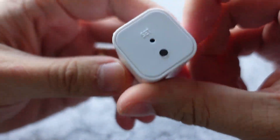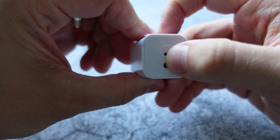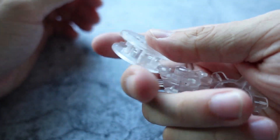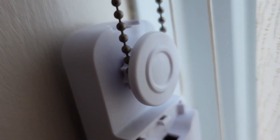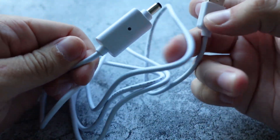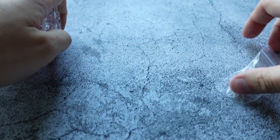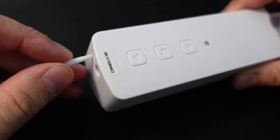You also get the WiFi USB dongle, which allows you to send a command from your Tuya or Smart Life app to the blind controller. The dongle takes your WiFi command and converts it into an RF command the blind controller understands. There's also a selection of different cogs you can attach to the controller for your particular pull cord or chain. As it's battery powered, a charging cable is included with USB-A on one end and a DC connector on the other. Finally there are some screws to mount the controller to the wall and a little pin tool to press the set button.